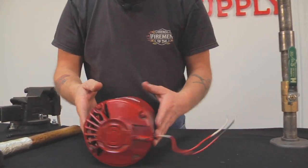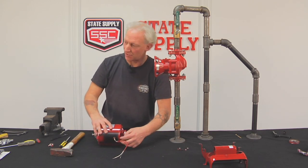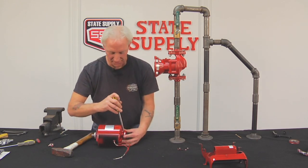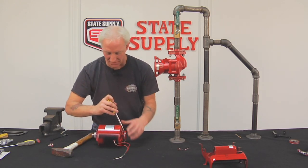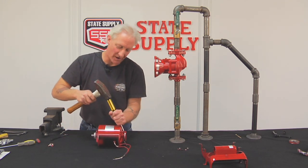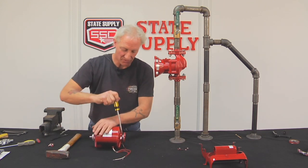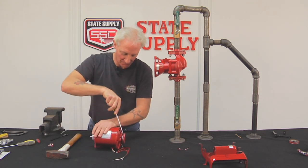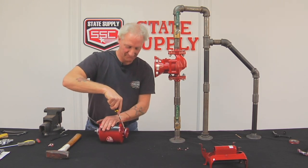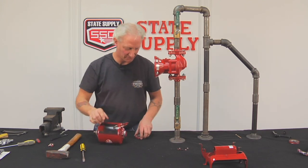Now I'm going to turn the motor around and do the same thing on the other side. Again, watch out for your oil tube here because it's plastic — you'll crack it. Down inside, lift it a little bit and into the rubber. Get your big hammer and give it a good whack. This one came off without tearing the rubber, so hopefully we can just pry it off. There — perfect. Throw it away.